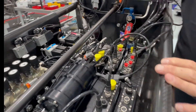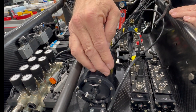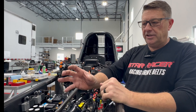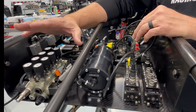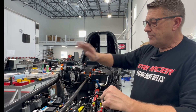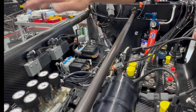Getting into this system further, a lot of this is the Race Pack stuff: driveshaft, main flow, return flow, and all the different components we measure as the car goes down the track. This is the hydraulic system for operating the clutch — this is where it's stored, and when we charge it we push fluid through the system which pushes out the cannon, starting our clutch system. When the car leaves the line, that bearing comes back and allows the levers to engage, which applies the clutch. We control that speed with flows and timers — when each flow comes on or shuts off — all through the Dave Leahy EM control module. This is the regulator setup for the alcohol valve, which controls how much fuel is running in the motor at any point on the track.